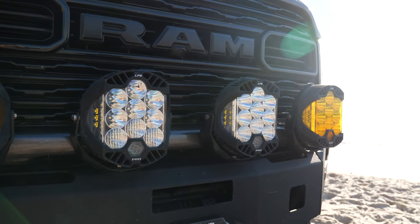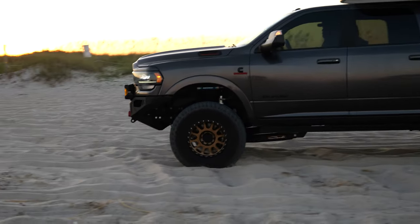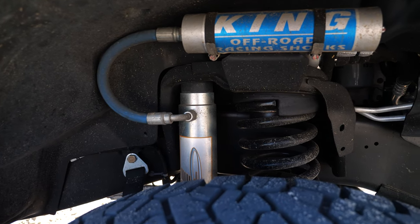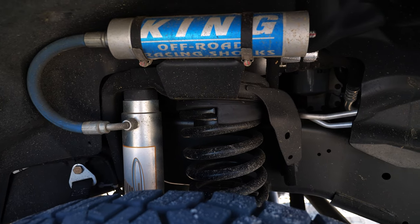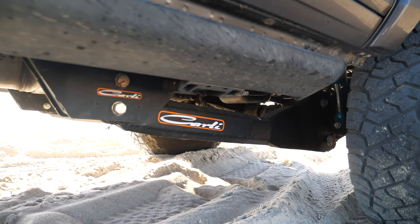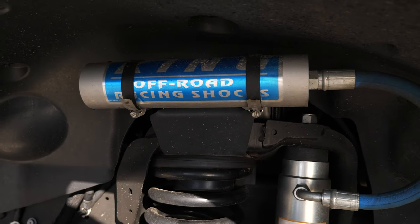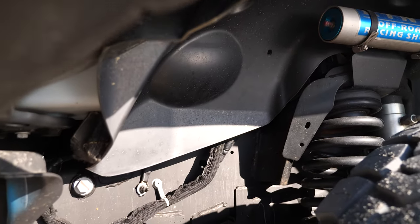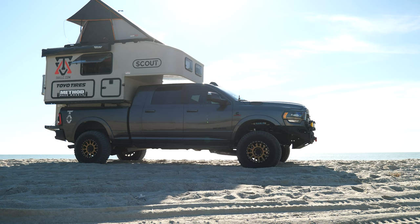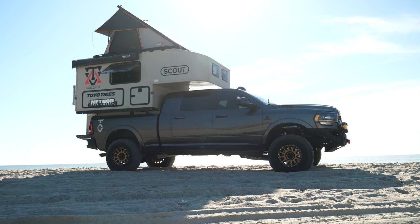As far as armor on the front of the truck, that's about it. For suspension, we work with CJC Off-Road and Carly, so we get our Carly suspensions through CJC. This is the Dominator 3.0 with all the accessories like the radius arms, steering stabilizers, and the fabricated sway bar. It handles amazingly — it's Carly's spring rate and their proprietary King shocks. As many of you know, we operate with King on all of our builds. This particular one was specced for the Carly kit, so the compression and rebound dampening is done through Carly.